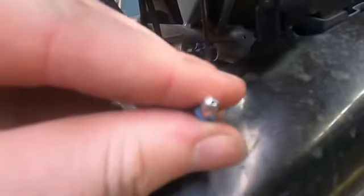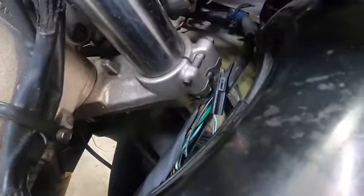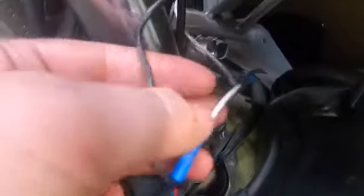It's just like a two-pin thing right there. You just plug in the power and the ground. So I went ahead and got this thing and poked the hole in the middle to make it bigger. I'm gonna put tape over it and then slide it over one of the pins so it doesn't touch the other one. I plugged that in and wrapped some more tape around it so it'll stay in. And then I got both the grounds hooked up and spliced into each other.